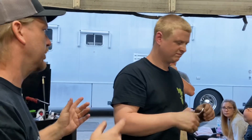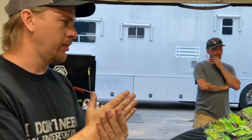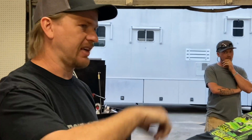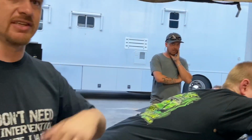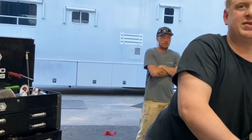180 degrees. So that's what we should have done to begin with, maybe. Right. Because I thought it was just a single marker, because some of them have just a single marker. Yeah, but if it's a half moon, we can probably just switch the firing order back to normal. And change it to digital rising instead of digital falling. That's how Jason Harris's was. Remember that? Fixed. Yes. His was on Haltech.